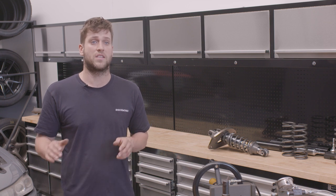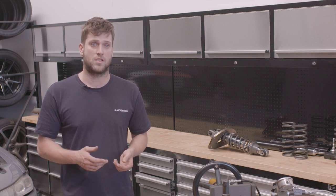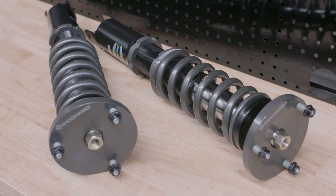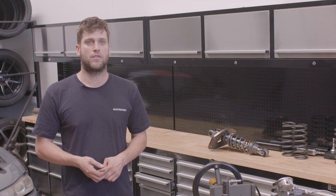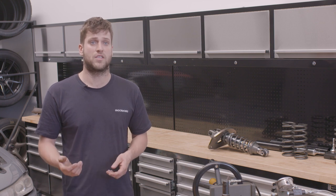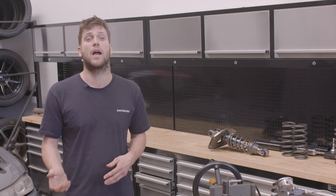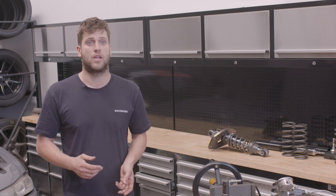Once the car is on the ground, you can trim the ride height with the spring adjustment collar. The more adjustment options a coilover has, the more setup work is required. If it's just a fixed height with only the spring adjustment, that's much easier to set up. With the base height set, you can always go back if you've made a mistake.